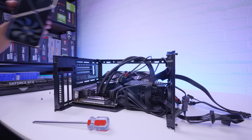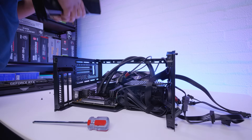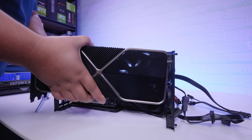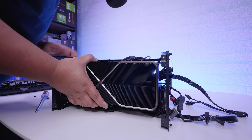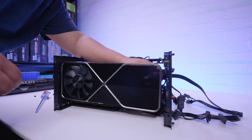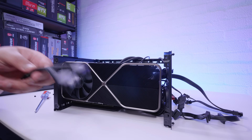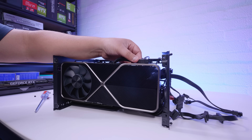The Founders Edition will be a little bit more tricky, especially with cable management and the fan on the top of the GPU. However, it should fit if you think about your cable management. The other thing with this card is it takes up a full three slots, so you will need to remove the third bracket on this case. With the same technique and the same amount of massaging, it does also fit. The cable management on the other side of the card is something you need to be aware of, but you can physically make it fit. The only other problem you might encounter with the Founders card is the power connector coming out at an angle and the side panel being able to close — but I don't see that being a massive issue because you can just run it across.